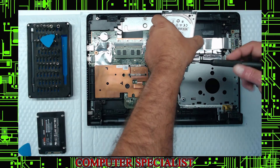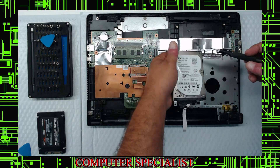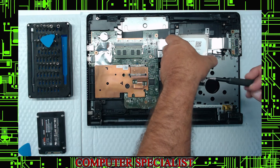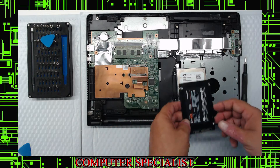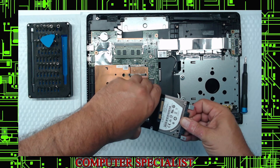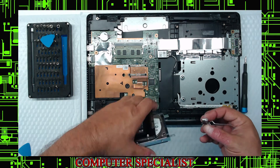You don't really need to put those four screws on the magnet because the next step is putting the new drive in. This is a Seagate thin drive — not a bad drive, but technology-wise old. I wouldn't use a machine without a solid state these days — it's such a better option for speed. Before pulling the old drive out of the caddy, take the solid state you're replacing it with and walk the ribbon connector off. This just pulls out and shouldn't fight you too much. If it doesn't come off easily, wiggle it — but don't pull on the ribbon; you don't want to damage it.